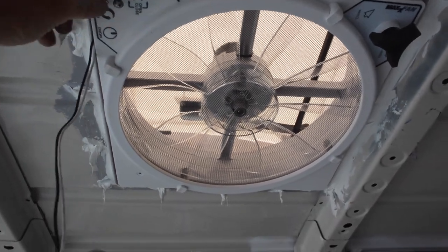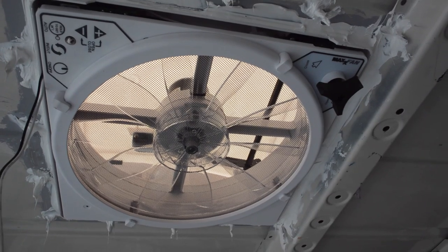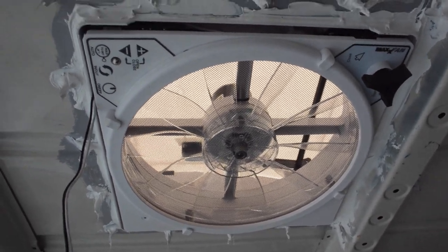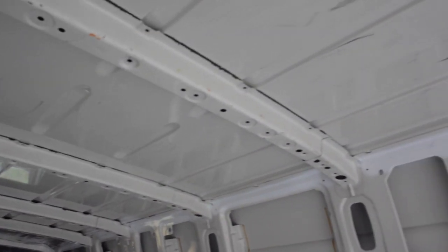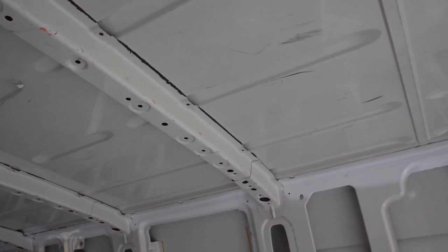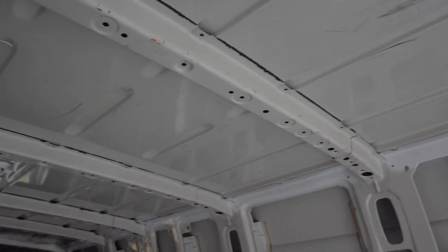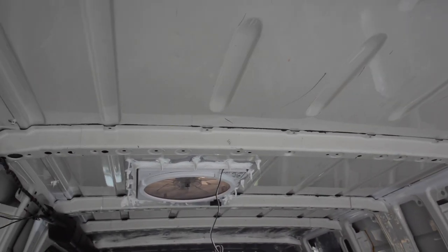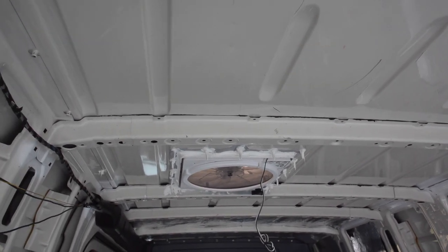It's a little 12-volt temperature fan. You adjust it. People have seen about them if they know about camper vans or RVs. It's got a thermostat in there — automatically opens and gets the hot air out. I worked out I could fit two more panels on the back, so that'd make it another 320 watts — 640 watts all up. From calculations that's about just under 50 amps, though they're never going to put out 160 watts during the day, so you take at least 10% off.